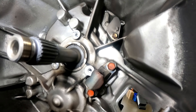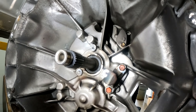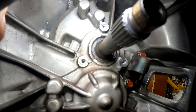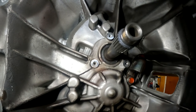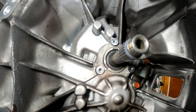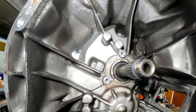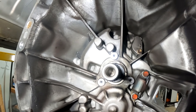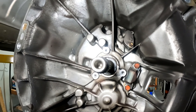Same with the other seal - this is where the slide is bolted and it covers that seal, so once you remove the slide you can see it. It's not bad, just a little moist. If you check out our store and buy our clutch install kit, we include all the parts related to this. It's always a good idea to replace them - it only takes an extra 10 minutes once the transmission is off.